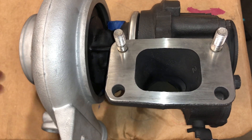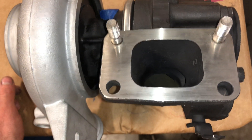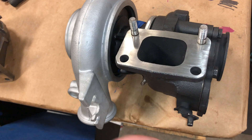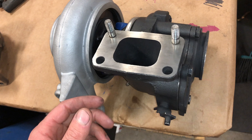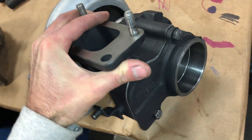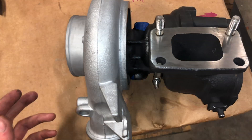The HX model bolts together with a bolt pattern — four bolts and two clamps. The HY35 also does not have the divider that you'll see on the HX model. This is a 9 cm turbine housing; the HX35 usually had a 12 cm, some had 14, and there's also 16, 18, and 21 cm. This is the HY35 turbo upgrade for the automatic trucks. If you didn't want to do the upgrade on the HY turbo, you could do the HX35 upgrade and just swap that turbo on there — buy a direct-fit turbo, sell your original, and get the turbo you want for your truck.